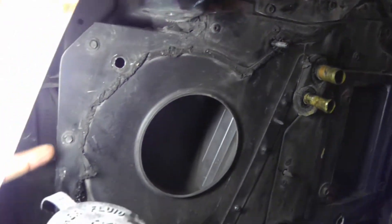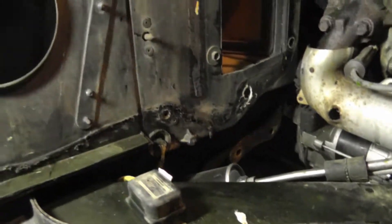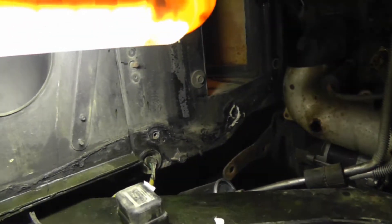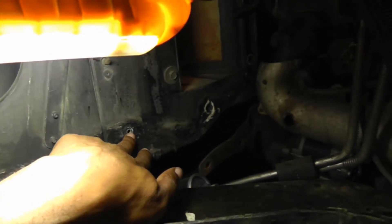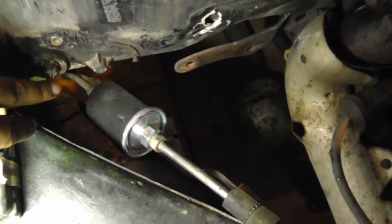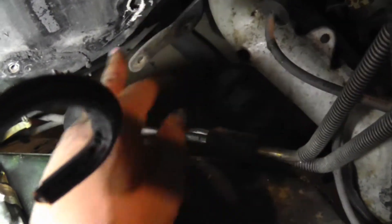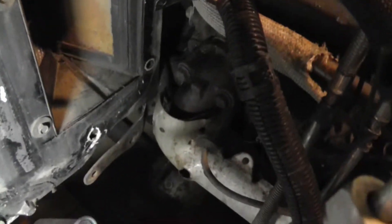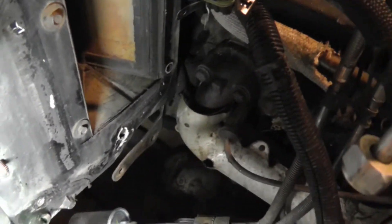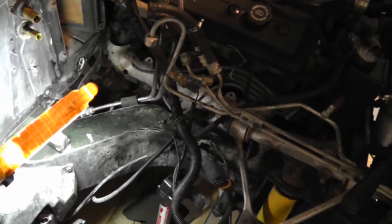I got the evaporator box off the wall. There was some sealant — maybe that's what the previous owner put on after they took it out and knew they'd lost bolts. There's a bolt right here: when you're down on the ground looking up, right beside the fuel filter you'll see a wire, and right above that yellow wire is going to be a bolt you need to take out. Mine just didn't have it. When I put it back together I'm going to go through that hole instead. You just need a 13-millimeter.